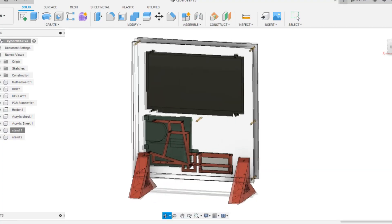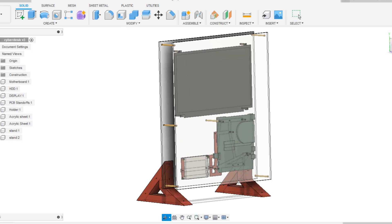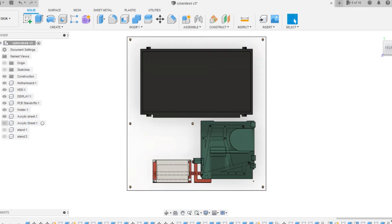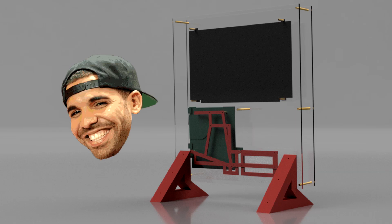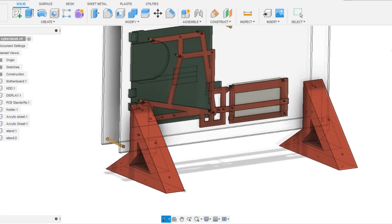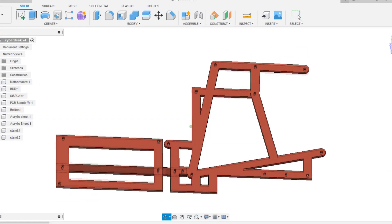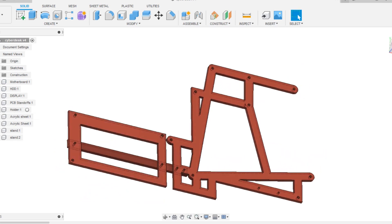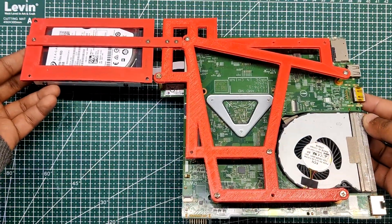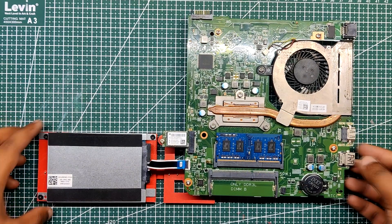Here's how the Cyberdeck PC is made. It's made out of two acrylic sheets bolted together with six M5 bolts. The motherboard, screen, and hard disk are all placed between the two panels of acrylic sheet. Using acrylic sheet allows the PC to be completely transparent, which looks amazing. Additionally, two 3D printed stands hold the entire PC and ensure its stability when placed on a desk. We also designed a motherboard holder that uses PCB standoffs and M3 screws to hold the motherboard in place and attach it to the hard disk drive. The red PLA was used to print the motherboard holder with a 0.4mm nozzle and 50% infill.